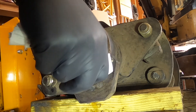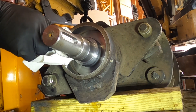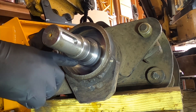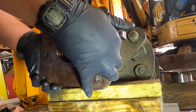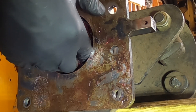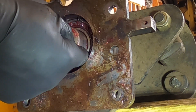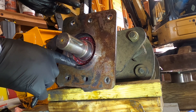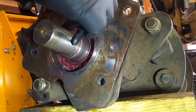Before we put this thing back together, we want to make sure everything is super clean — we don't want any dirt in here. Make sure there are no big nicks or dings, and we're going to slide this right on. That one just slides right in — pretty straightforward. Then we'll get the smaller C-clip and put it right in there. You can tell we got good grease in there from packing that bearing. As I spin it, you can see it kind of rolling out — that's kind of what we're looking for.